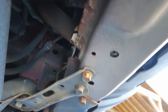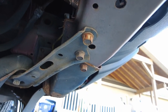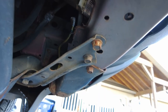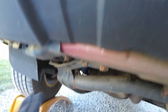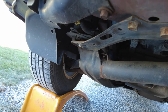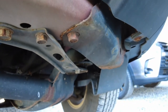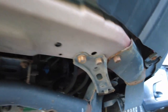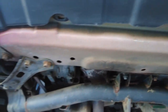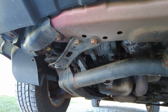Step one is to get these bolts out, then work on getting the plate installed. You will notice if you've spent any time underneath your Pilot that this front plastic valence has been removed. You're going to have to pull that off — this was already off on this one. There are several plastic pop clips and things like that you're going to have to take out to get it to this state, but this is what it looks like in order to get the plate installed.